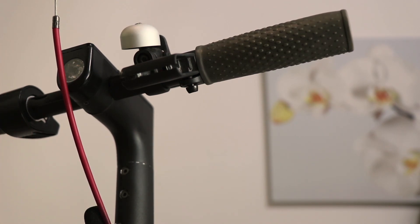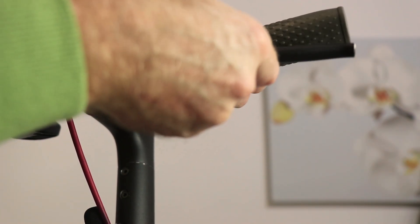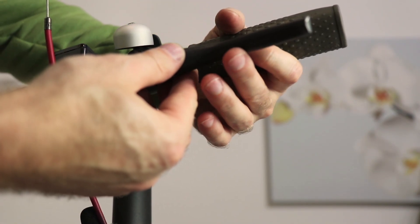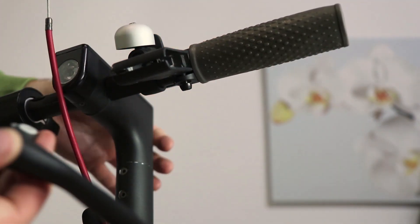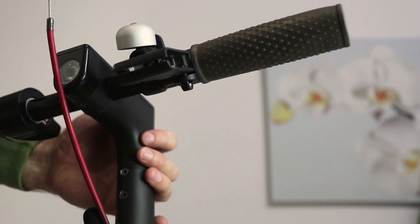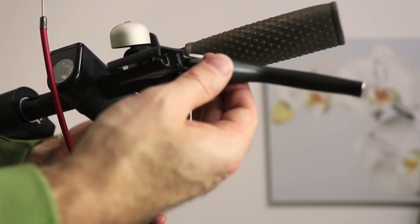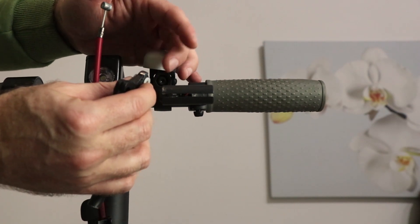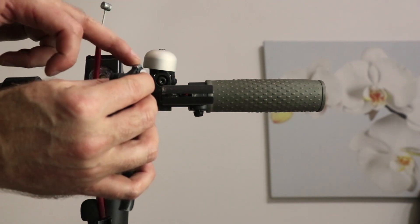I will put the magnet inside and we will check if it is now not beeping. It doesn't beep. I am removing the magnet — it doesn't beep. But when I turn off the scooter and turn it on, it is beeping. Sometimes the magnet is not correctly glued, so error 15 can come up just because it is out of place.